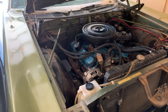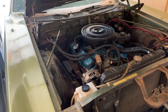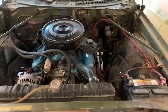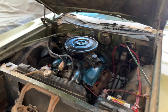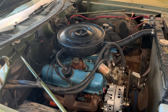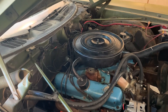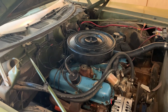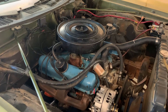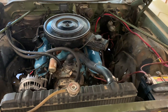To make a super over-exaggerated story short, I drove it around the block after dialing it in. It ran and drove just fine. The alternator was doing its job, all the accessories were staying on, and the headlights were not getting dim at a stoplight. But I got it back to the garage and just about 500 feet away it died on me. I couldn't get it to start — it was getting spark and fuel, it just wouldn't start. I finally ended up tweaking the distributor, ran and grabbed a wrench, started tweaking it ever so slightly, finally got it to run. But it was running terribly and lurching around in the engine bay. I shoved it into drive, got it in the garage as quickly as I could, put it back into park, and immediately it died again.